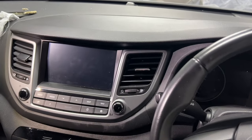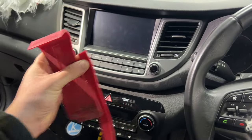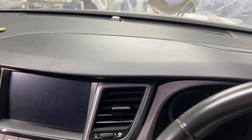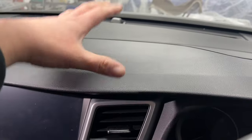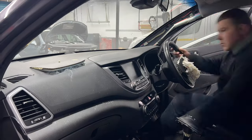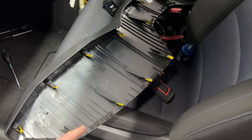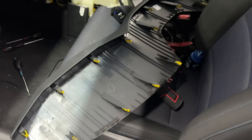Next step, I'm going to remove this top piece. You want to get a couple of pry tools — a couple of different sizes. Get in this corner first with a small one, then you can get the big one in. Basically this whole trim is held in by loads of clips. Get a small one in here just to make a gap, then get the bigger one in. When this pulls up, pull it towards yourself. I'm removing that so I can remove the screen, all the buttons — and that's also how you take the speedo out. As you can see, there are loads of trim clips.